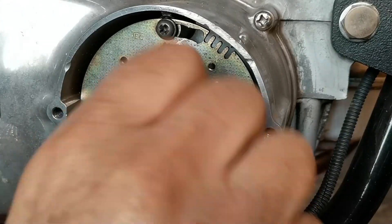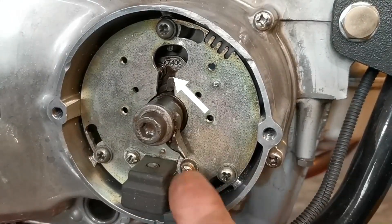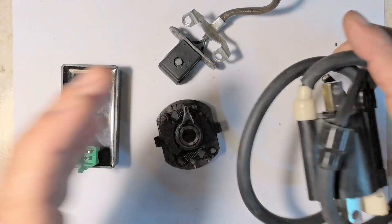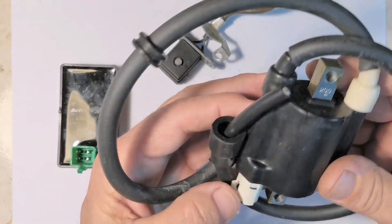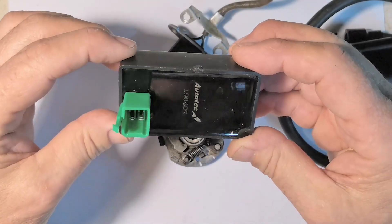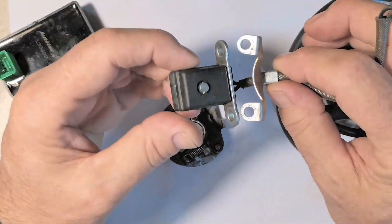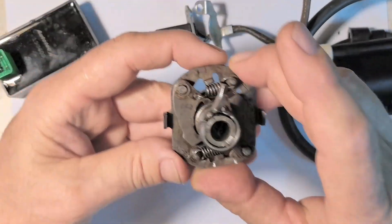We now see all the components that make up the system. Regarding the high-tension coil — this one belongs to a Bajaj Pulsar, and the motorcycle has an identical one; it is a dual-output coil that produces simultaneous sparks on each of its cables. In that way, one spark coincides exactly with the cylinder in compression — the one that will fire — while the other is a wasted spark. Regarding the CDI, there is not much to say: it is the classic 4-pin type, battery-powered, with built-in advance, found on most Chinese 4-stroke motorcycles. Regarding the pulsor, also not much to say — it is a common coil, widely used in all those Chinese motorcycles.